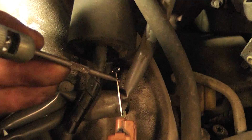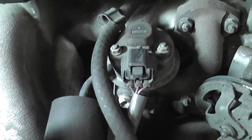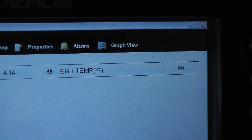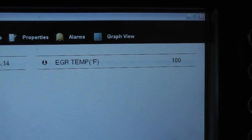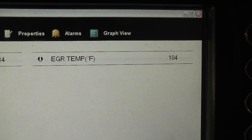There's a position sensor on top. So I take this again, touching the test light, forcing vacuum to the EGR valve. Watch my EVP signal — it rose. And my EGR temperature should be rising, telling you there's flow through that EGR passage. And it is rising as well.